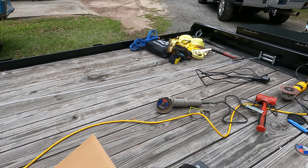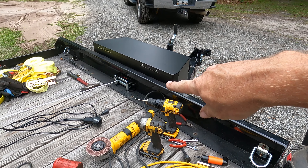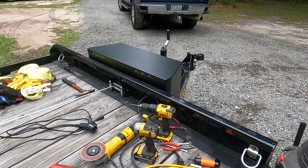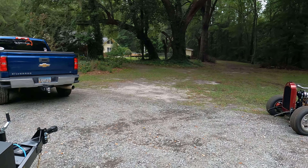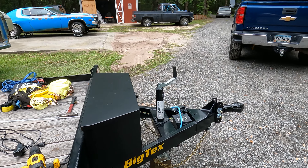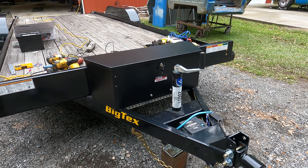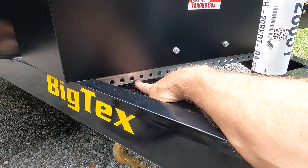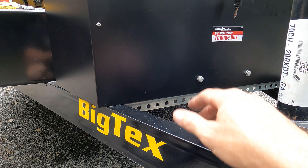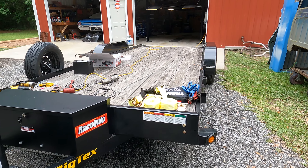This looks like a big mess, but it's all basic hand tools. You don't have to get as extravagant as we did — you could simply weld the winch plate right there and buy a bag to cover it. I wanted everything hidden because we travel a lot and I don't want moisture rusting out my equipment. We're also going to bust out the welder and weld two eighth-inch steel pieces at both ends of the frame. It's pretty solid now — we'll put it to the test tomorrow when we go grab another vehicle.